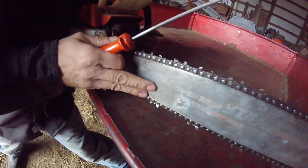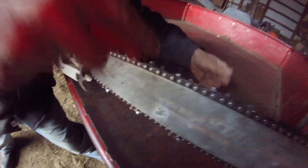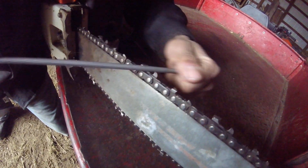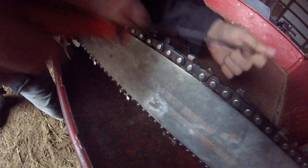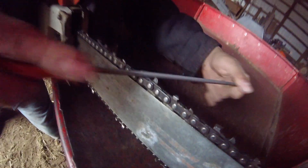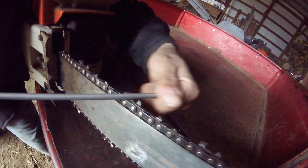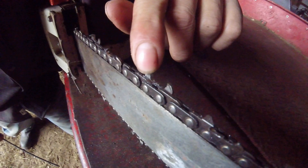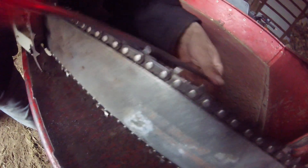It's a bit awkward here, but there we go. Gullet out. Keep your tip down at about a 5 degree angle. Just work it across that top plate. And remember, it's not all about the tip being sharp — this whole top plate has got to be sharp all the way across underneath it. It can't be blunt. Gullet down.